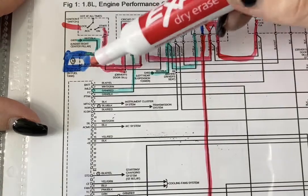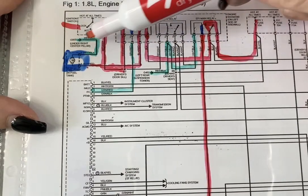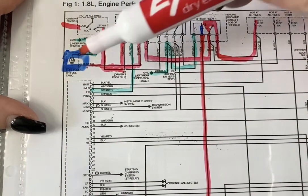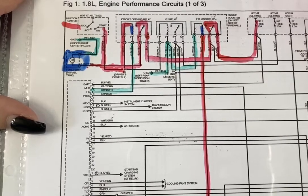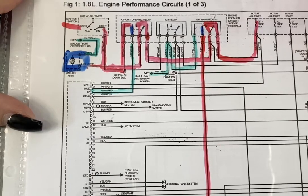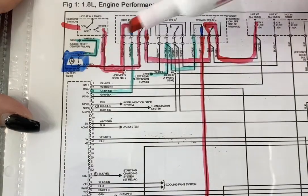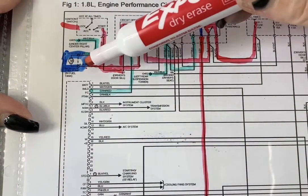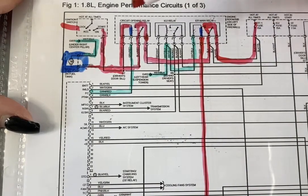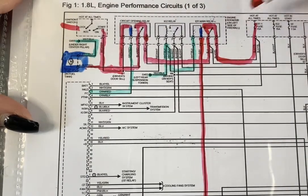If my fuel pump is not working, the first thing I'm going to do is test for voltage going into the pump. If I have voltage going in, I'll then test for voltage coming out. If I have voltage going in but not coming out, I replace the pump — it's getting power and ground but not working. You can also use a 12-volt jumper box directly: if it turns on, the pump is fine; if it doesn't, the pump is bad. In this case, 12 volts in and zero volts out with no pump operation means a bad pump. But let's say I have no voltage going into my pump at all — I'm going to check my relays.